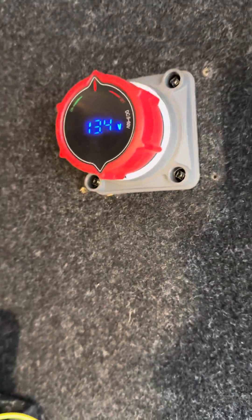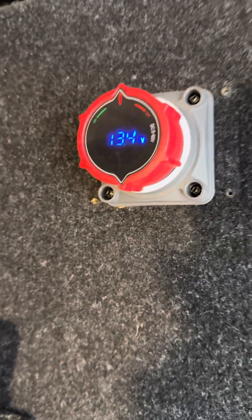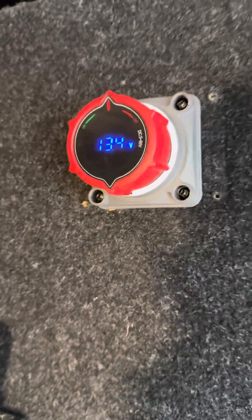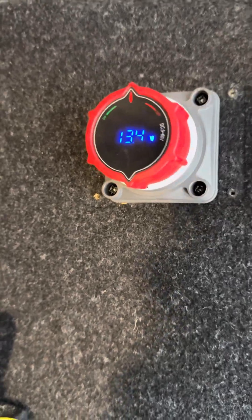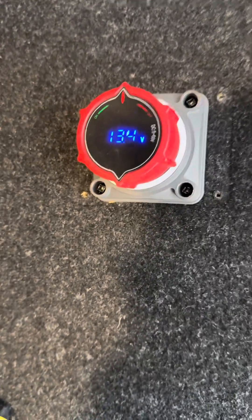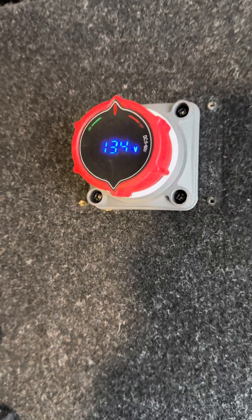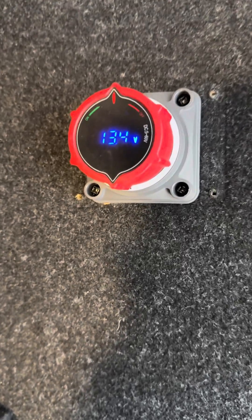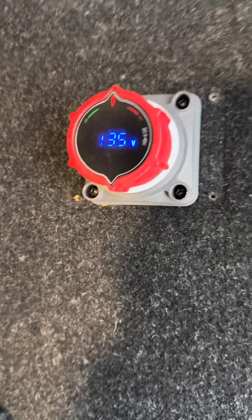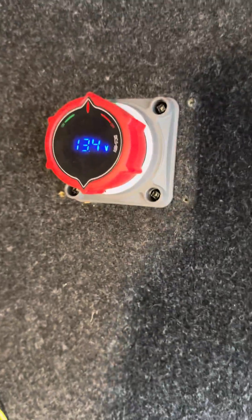So now we're installed, all is well. Pay close attention in the back when you hook up the two 12-volt wires. In my particular installation, one of those 12-volt wires goes over the top of the negative connection for the voltmeter, so I made sure I bent that wire up a little bit so that the lug does not make contact with the negative connection for the meter. Pretty much a straight swap from one to the other — my hole was the same size, the only difference was the mounting holes for the meter were in a little bit different place. As always, thanks for watching and please remember to like and subscribe.